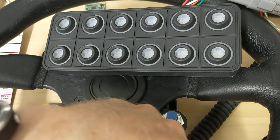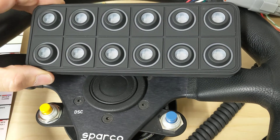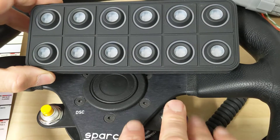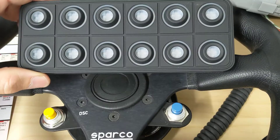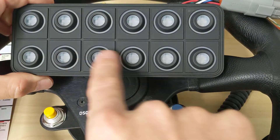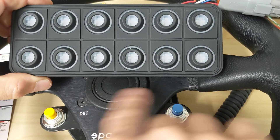I've got the steering wheel wired up over CAN bus here. It's on the same baud rate as the micro PDM, but right now it doesn't do anything. Nothing is configured to work. I can press buttons and nothing happens through the micro PDM. Let's go ahead and change that — let's change these buttons to map up with the buttons on the steering wheel.